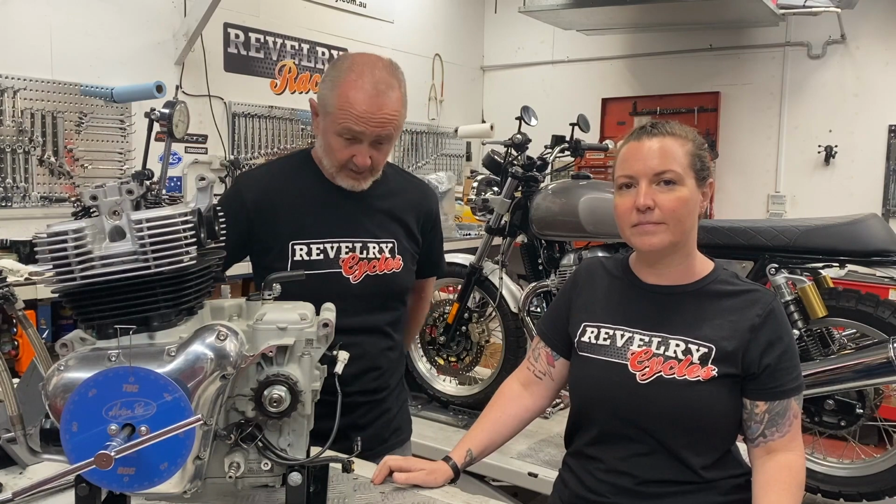In some of our previous videos, we've made mention of cam timing. And so today we want to take a deep dive. We showed you some dyno charts in previous videos where there were two 865 motors that were basically identical, and the only real difference between them was the cam timing. One of those had about 4 degrees retarded timing, and one had about 2 degrees advanced.